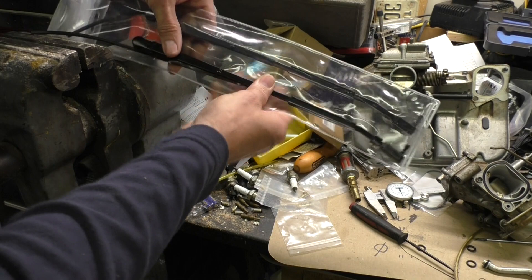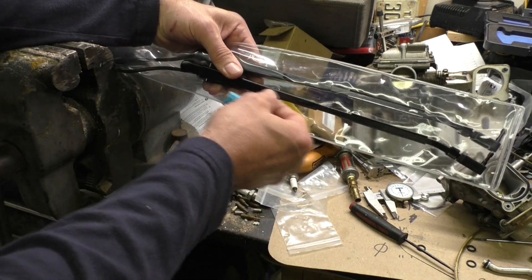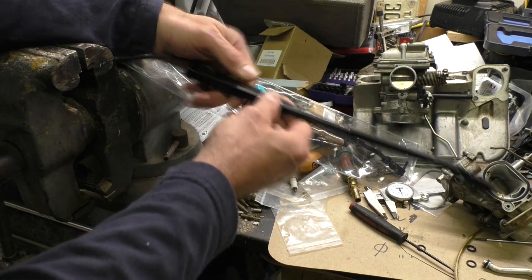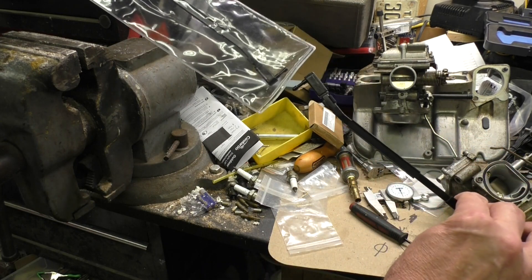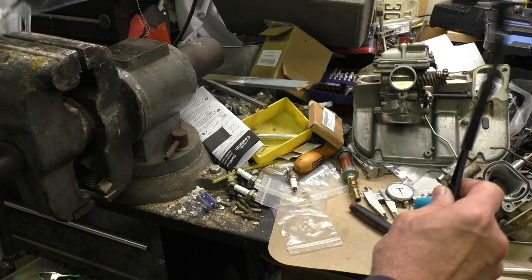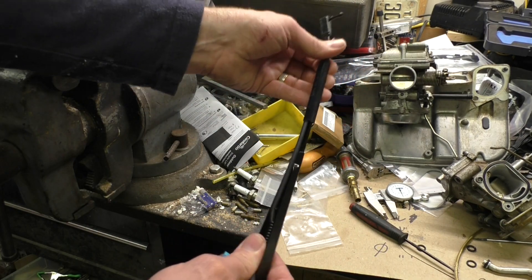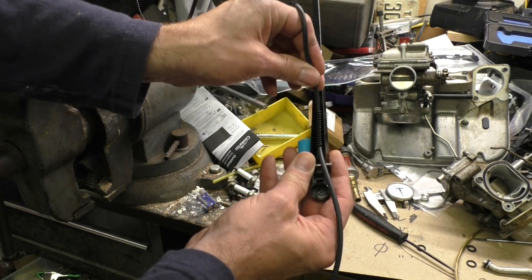We need to make some modifications - lengthwise they're the same and they'll accept a more modern wiper blade. So what we need to do is take this rivet out, pull this arm portion out of the sheet metal part, flip it over and attach it somehow. They'd both be the same hand or direction, which would look ridiculous on the truck, so we want them to be mirror images. This one has a hose and a little squirter for the rear wiper wash function - I think for right now we'll take that off.